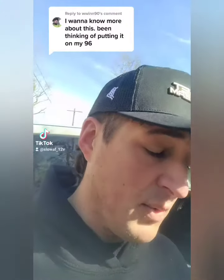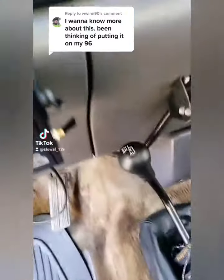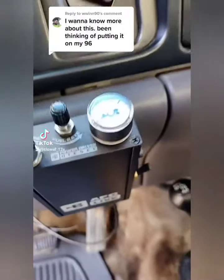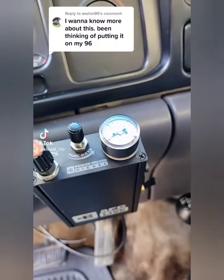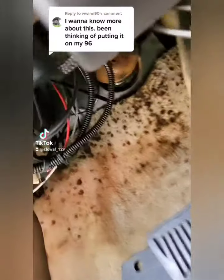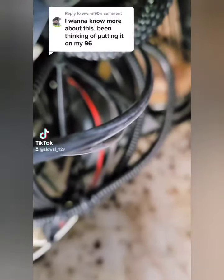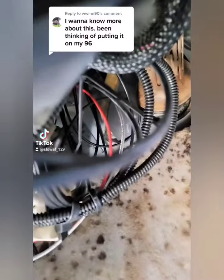In compliance with this question about the AFC Live install — it's not a difficult install by any means. The biggest thing you're going to run into is finding a spot where you actually want to put it. I mount it right on the lower dash panel there and just run my lines back under, back through to the plug. It goes right into the engine bay.